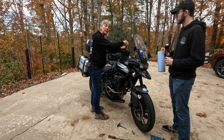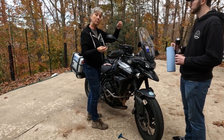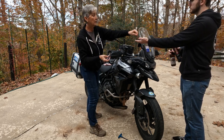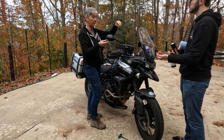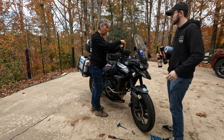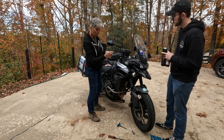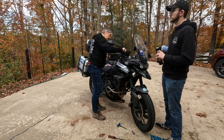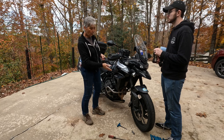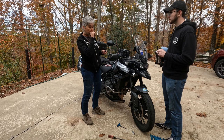So I proceed to assemble my little screwdriver. You take the screws all the way out. And it's always handy if you can get one of those magnetic bowls to keep all your parts in. I'm going to give Van my little screws and he's going to put them in a safe place so that when it's time to put them back on the brake reservoir, I don't have to go digging around. That's step one. Step two: loosen that brake reservoir cap. You don't have to take it off, you just got to loosen it so that when you push the pistons back, the hydraulic fluid has somewhere to go — so you're not fighting it.